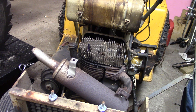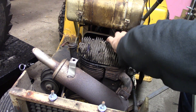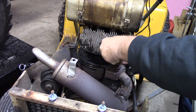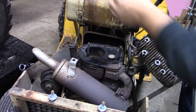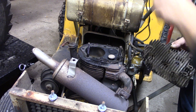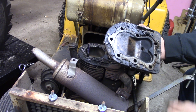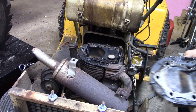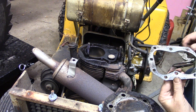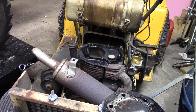The top part is slotted but this one isn't - it'll be fun getting my fat fingers in there. Make sure we get the two washers off the studs. She doesn't look as bad as I thought she was going to look, but you can see all along there that whole side was leaking - we definitely weren't getting any compression. The gasket is all super wet along there. I'm going to grab some cleaner, get this cleaned up, and get that new gasket put on.